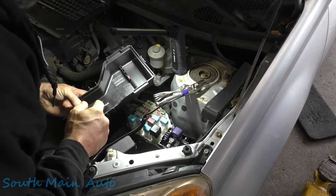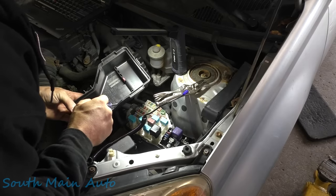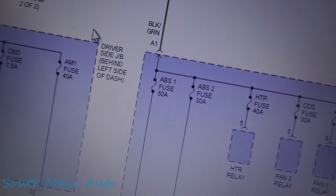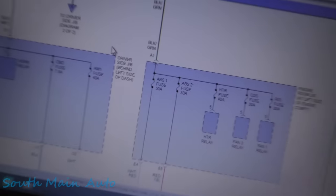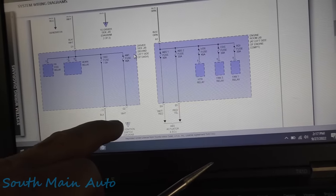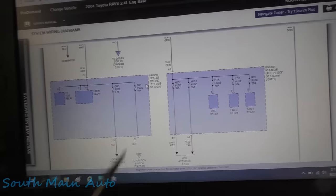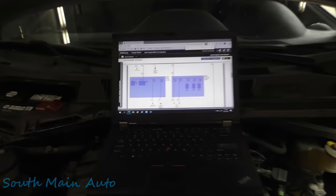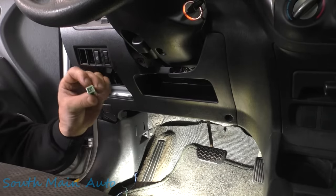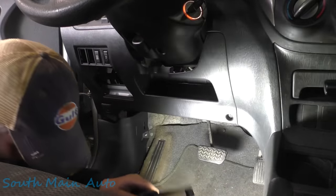We need to find the AM1 fuse — it's going to be a 40-amp, so it's a bigger one. It says AM1 — driver side junction box, behind left side of dash. I'm getting a little excited over here, but I think it's probably going to be good. Because we didn't have a horn either — the power that feeds the horn relay feeds this fuse. Let's check it anyway. I pulled the 40-amp right out — yeah, it is also dead. It's a big J-case fuse. I'll stick that back in and then we'll go to the main — the big main feeder out there under the hood.